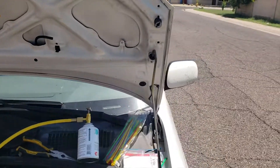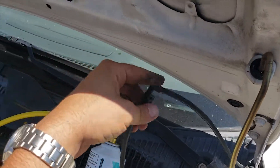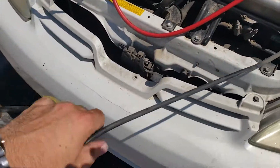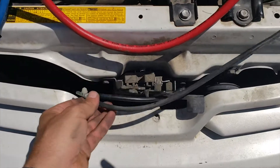I took off a little hose that goes to the windshield washer sprayers and I'm routing it through here. I'm going to have this spray on the condenser. And I was wrong — the little radiator up front must be for the inverter coolant.